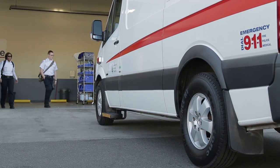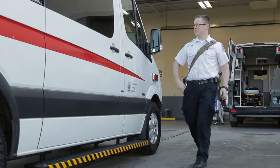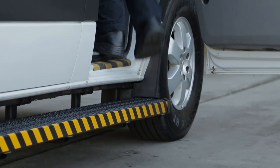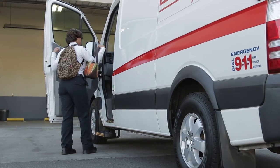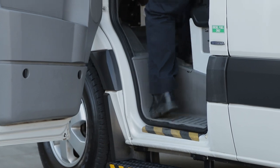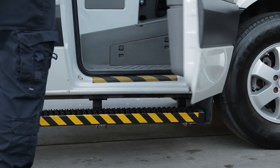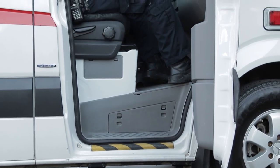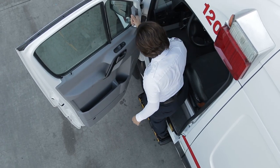So what are we going to do to reduce the chances of injury? First, we're going to add a step. Steps should occur naturally at about every 12 inches, and we want to mirror that even on our ambulances. We're going to make that step very clear and visible by adding reflective tape, so it's obvious as you walk up to the ambulance. We're also going to add reflective tape from the top, so as I step out of the ambulance, it's clear where you're stepping.